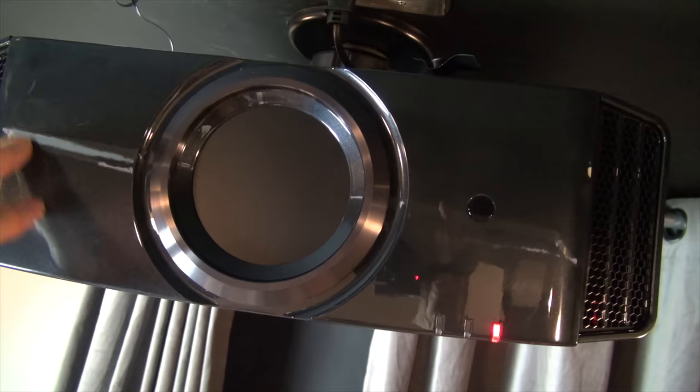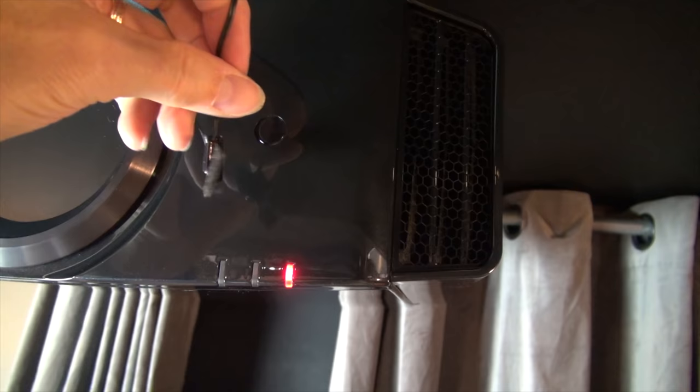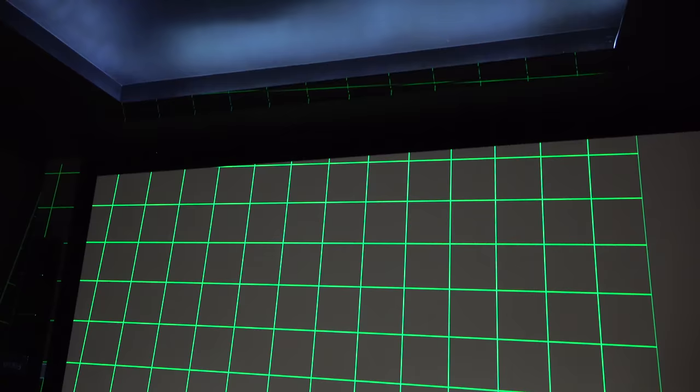Might need a little adjustment. So what I do now is adjust the projector based on the screen, then lock it with that ring at the top. This here is my infrared blaster, so I'm going to put that on there and tape it on, then hook it up to my Control 4 so I can control the projector from the remote. Now with the projector mounted, it just takes a little tweaking — I'm going to use tilt and yaw — to make sure it fits in the screen.